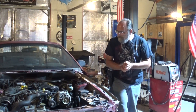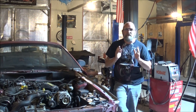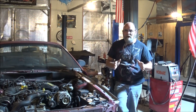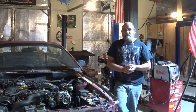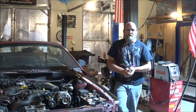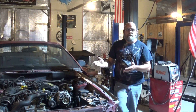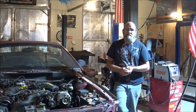Don't forget, when you're pulling your plugs out, make sure that engine is cold — and I mean cold. It's been parked overnight or the majority of the day. You do not want to take a plug out of a hot motor. That's how threads get stripped, because the majority of the heads nowadays are aluminum, and it's easy to mess them up. So y'all keep that in mind.